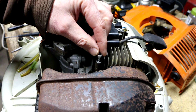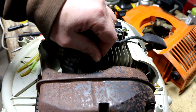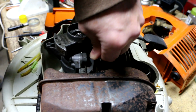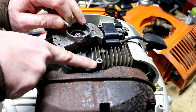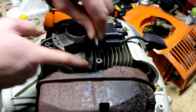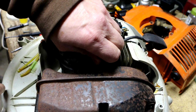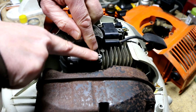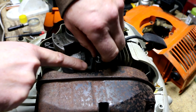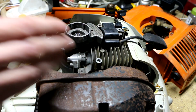I can push this screw in. I can actually literally push it in. You can hear it pop in. What has happened is all the threads up here near the front are toast. The threads way down in there are still good enough for this thing to tighten, but by the time I get it in far enough for that to have tightened, this space right here isn't enough. In other words, no amount of tightening will work.